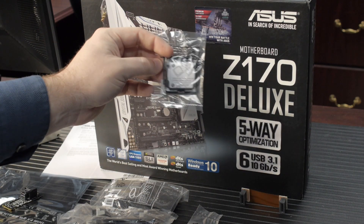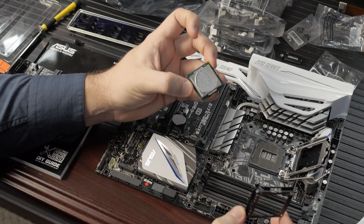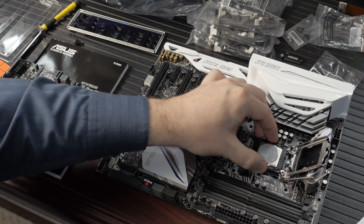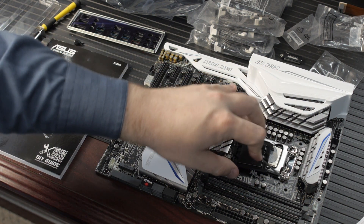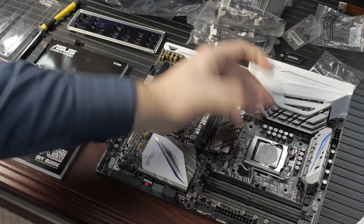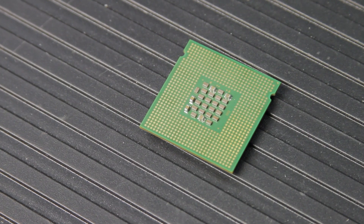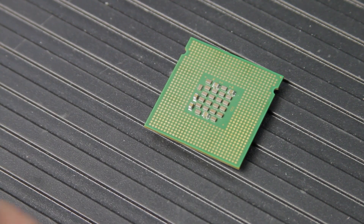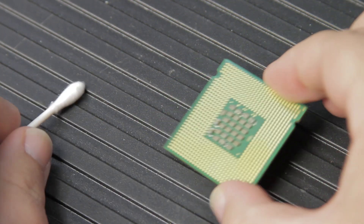You've also got your SLI bridge, and this little plastic CPU installation helper — you snap your CPU into it and then snap this into the motherboard socket. These LGA sockets are insanely sensitive and delicate. It's very bad if you accidentally touch the socket, drop anything in it, or look at it sideways. Do not taunt the happy fun CPU socket. If you do accidentally touch the pins on the bottom of the CPU, you can clean the fingerprint oils off with a Q-tip — clean it off until you're absolutely sure there's no oil left, then continue cleaning for another five minutes, and perhaps you will not have destroyed your CPU.